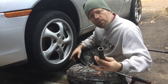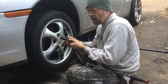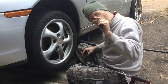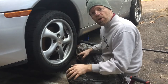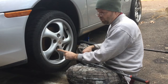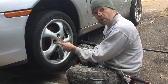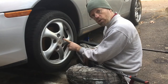What I like to do is put them in hand tight first. Just screw them in — that one's hand tight. Then you go to a star pattern. You never want to go around the circle because it could offset the rim — pinch one side closed first and leave a gap, and you'll feel a shake or it won't run right, or it could break the studs and ruin the rim. So you go one, two, three, four, five — make a star. It's called star pattern.